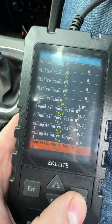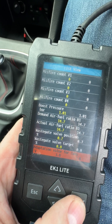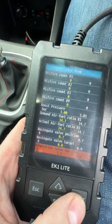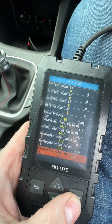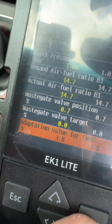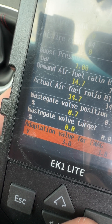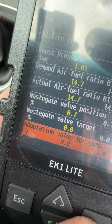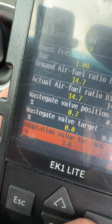I've already done this adjustment on my car. But if yours was 4 volts or maybe 3.6, both of those would warrant adjustment while the car is cold. You're looking for it to be about 3.8 volts when cold, and then 3.6 to 3.7 volts when the car is hot. Let me show you how we adjust that.